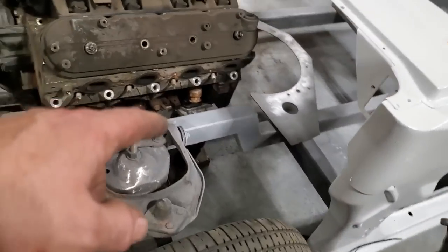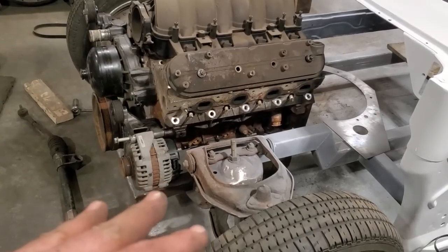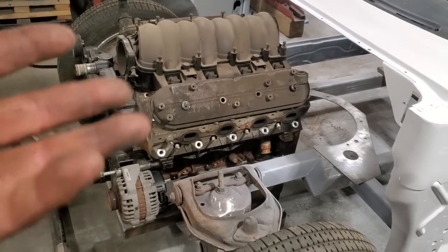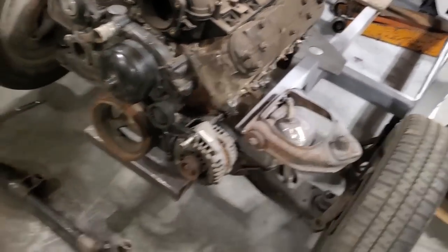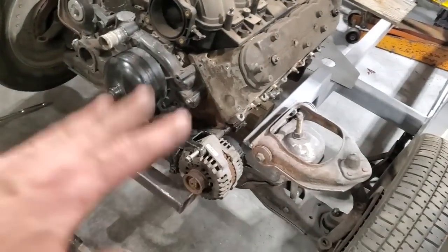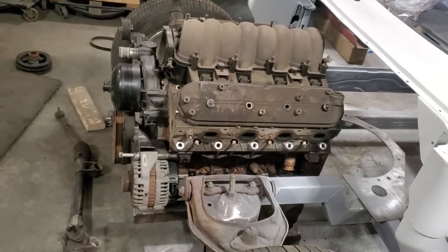Down here on the bottom, if I had to raise the motor up for the pan, because I don't want the pan hanging down below the cross members, the bottom of the car, because the problem you're going to run into is that if it ever wheelies, and it comes down hard, you'll end up beating the bottom off it. Even on a road, you hit a pothole or anything like that, the base pan will be the lowest point, right? I don't like having that. I like to have it so that if it ever bottoms out, it'll bottom out on the rockers or on the suspension or something along those lines. It won't bottom out on the base pan. Hopefully, okay? Got to sit down and figure things out here.